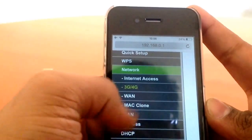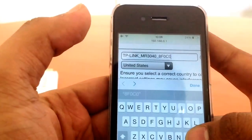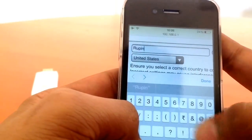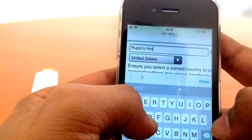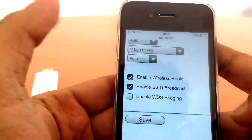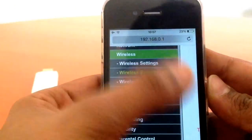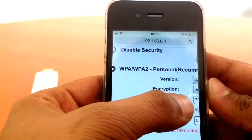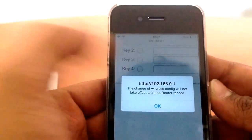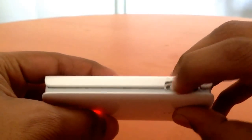You can also go to Wireless and change settings if you want. For example, you can change the name of the hotspot — by default it's TP-Link MR3040, so you can enter any name you want. Click Save. You can also change the security settings and set the Wi-Fi password to whatever you want using WPA/WPA2, then click Save. The system will notify that changes won't take effect until you reboot the router. Switch it off using the power switch and switch it on again.